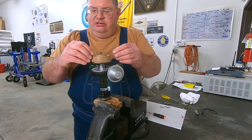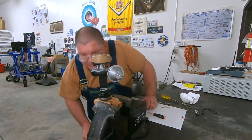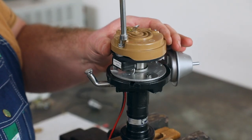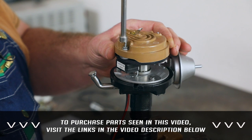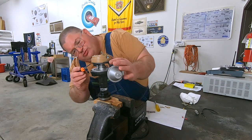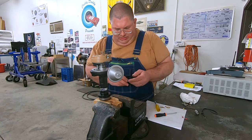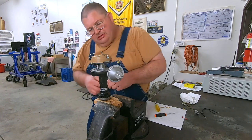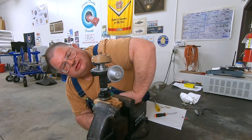The steel-colored flat washers go on, then we have the locking nuts, and we will just gently snug those down. Now what we need to do is check the clearance right here between the magnet ring and the pickup. We need to see between 10 and 60 thousandths.